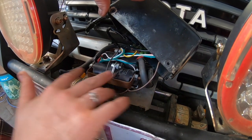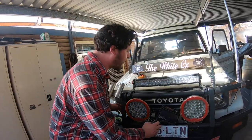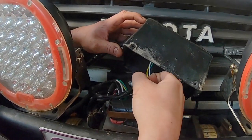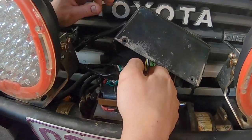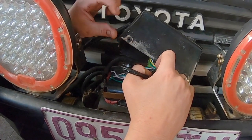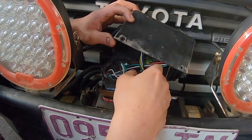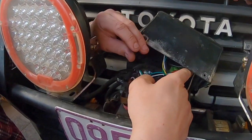That's your standard solenoid — this is actually a bigger one, I think it's a 62891 or something like that. To wire the in-cab switch, what I had to do — you might be able to see here — I used a four-lead trailer wire. This is just normal trailer wire which has got a connector in case I want to get it off again. To do the wiring, I basically had to tap into each of these solenoids. It took me a while to figure this out. This is only for these Warn winches — I can't speak for any others.